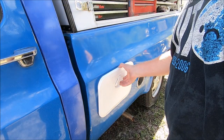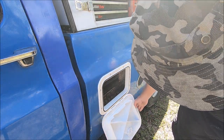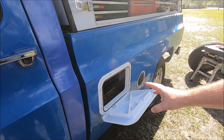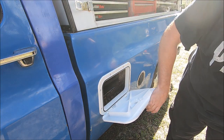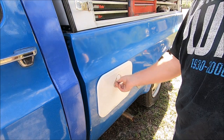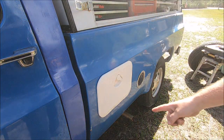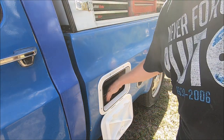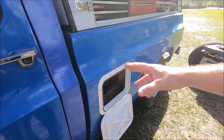I've got two more screws to put in, and then I'll be able to reach in and pull start the generator. The hatch makes everything accessible — here's the pull cord and the switches. The fuel switch and choke are back up in here. It's a little bit of a reach for the choke — I might put a rod to activate the choke — but that means I don't have to crawl into the truck bed, and the generator weight stays in the front of the truck. Those were my main goals.